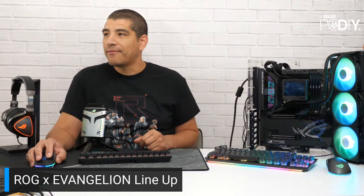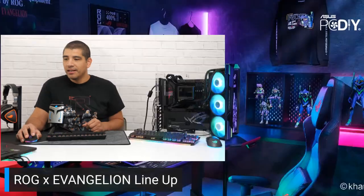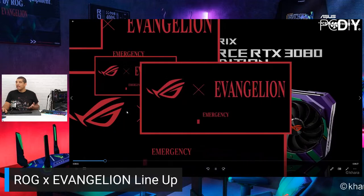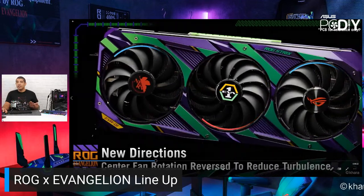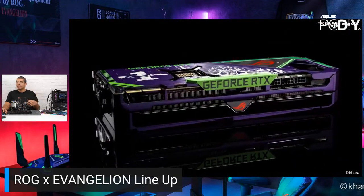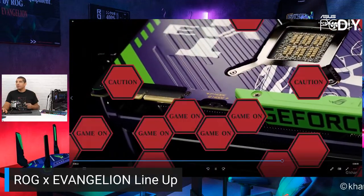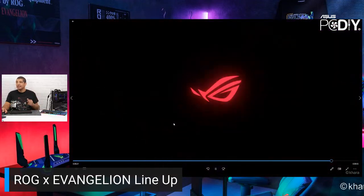All right, so next up, let's see. We've got now the graphics card, right? I'm sure most of you have already seen the beautiful cards we already have in our ROG Strix series graphics cards. This is going to be for the 3080 and for the 3090. It features that triple fan design with our axial-tech fans, which have great static pressure performance, that really cool ARGB lighting zone on the side, which is still customizable, higher than standard TGP and TBP board power limits to give you even better performance, and a dual BIOS design. It also features our advanced max contact heatsink.